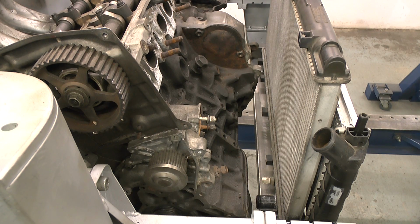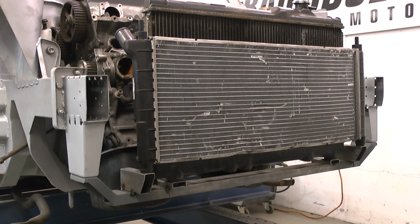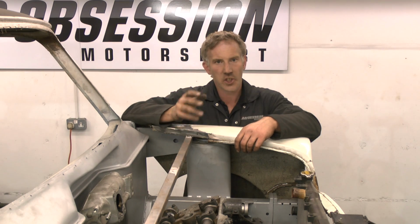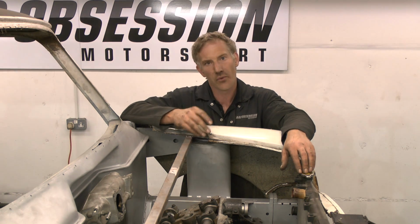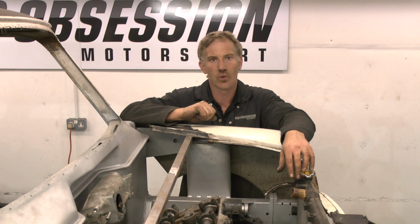Now without all the ancillaries in the way, there's loads of room for the coolers. There'll be a lot of thinking time needed in order to get them all back in again, but for now, this is a nice step forward. The header tank on the main radiator is, of course, higher than the highest waterway in the head. The next job should be to make up a frame to support the tops of these two radiators. It's that tight in there, there's no point doing it until I've fitted the new front panel and new wings. I can't do that until I've sorted out the doors.